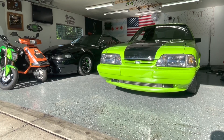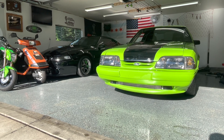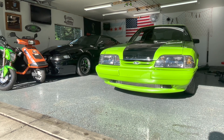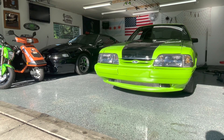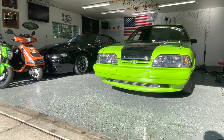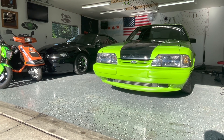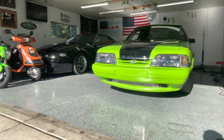Just a little background on the car — it's your basic turbo LS setup. I have a Holley race manifold with a 92 millimeter Holley throttle body. I have a brand new Holley IAC and also bought one from AutoZone. Neither of them seem to work correctly. After research, it seems like both the Holley and the AutoZone IAC for the Holley throttle body use a Chrysler-style wiring setup. There are two different pins that need to be swapped in order to get it to work correctly.